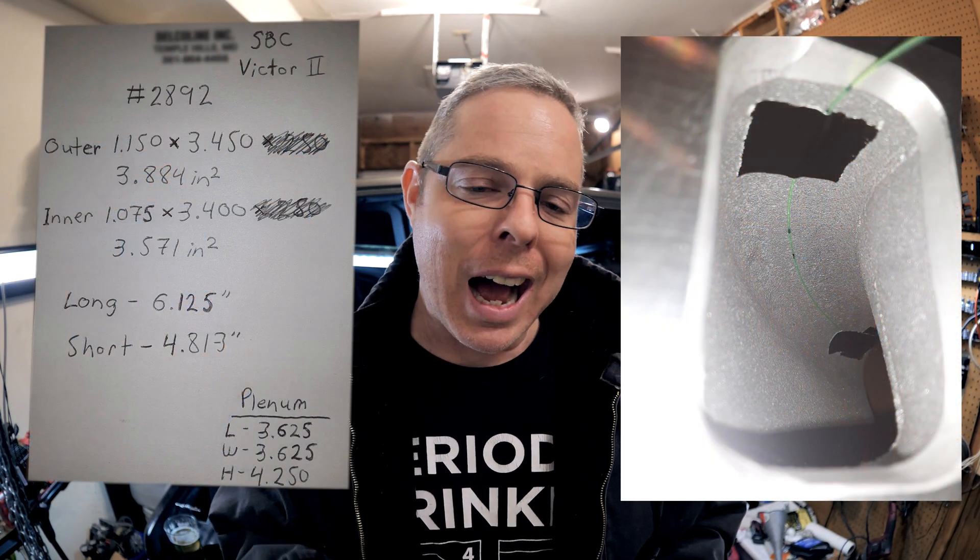If you're trying to make more power down low, you pick a cam accordingly to your power requirements. When I say doing it correctly, he actually measures the intake runners, the height, cylinder flow on those heads from a flow bench. So all these numbers aren't just nilly willy numbers thrown together — these are actual numbers from the motor that's going to be built. That's why his calculations are probably going to be more accurate in lines of horsepower and the curve of the cam, as opposed to just using something like Comp Cams Cam Quest that has generic numbers. This is all based off of real world data and real world measurements of this motor.